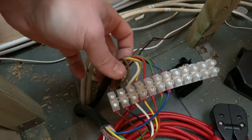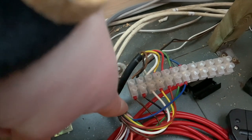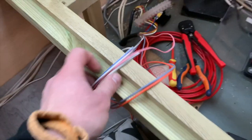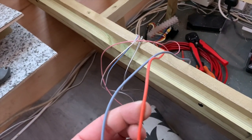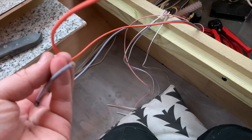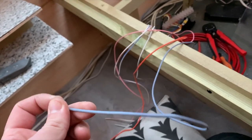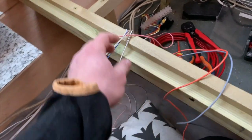The wire that was in the caravan - now I'll be connecting all these. The colors are the same between the 13-pin and the 7-pin, so that's cool. So this goes back to my lights, my road lights, and then these are what remains. Now because these two wires are thicker, I'm gonna use the orange which should be the reverse light in the standard configuration. Because the orange is thicker I'm gonna use this as a plus to charge my battery from the split charger from the car.